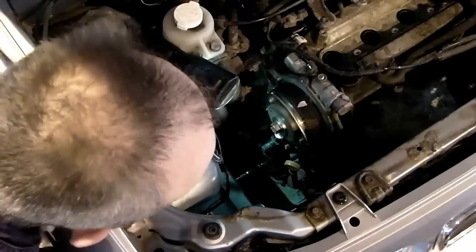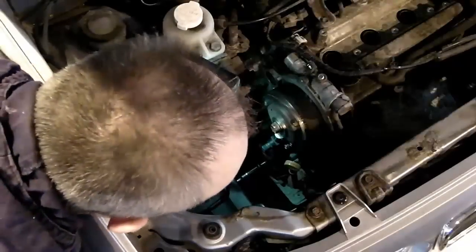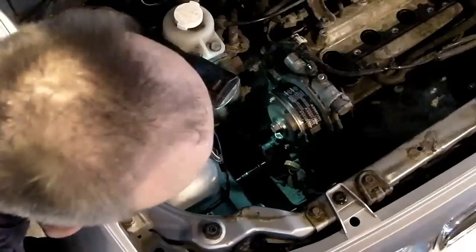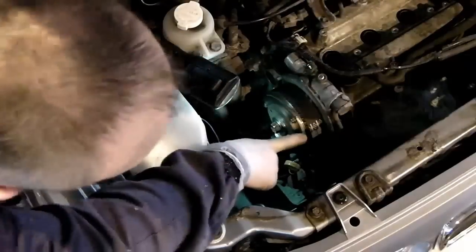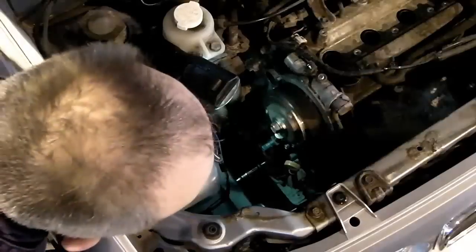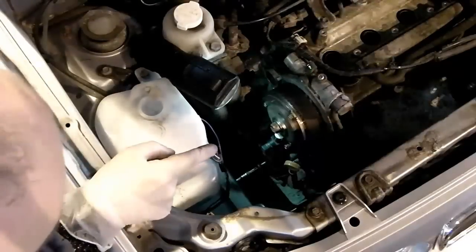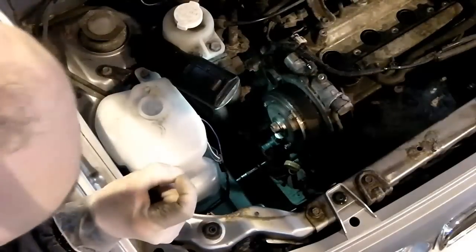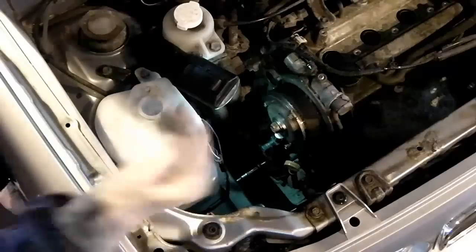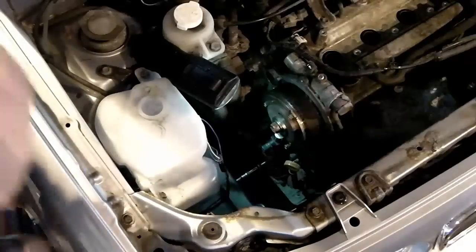And what this does also is it helps the belt to centre itself on the pulley. There you see the writing that I was referring to, and the bit that you could see lined up on the tooth was this bit up here. Quite a lot of timing belts have several bits of writing all over them, which is handy. Something I meant to mention, always check before you fit a timing belt to see if it has an arrow denoting direction of rotation. Some do, some don't. If they don't, I tend to put it with the writing facing towards you, like you saw there. If they do, then make sure it goes with the direction of rotation of the engine.